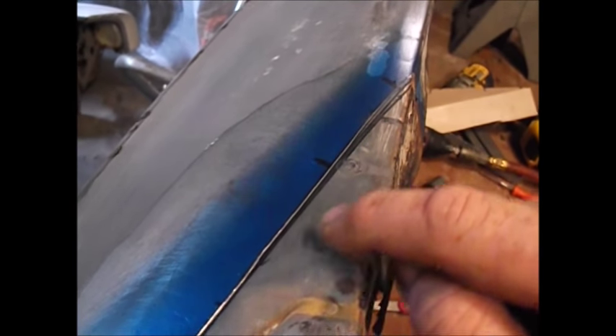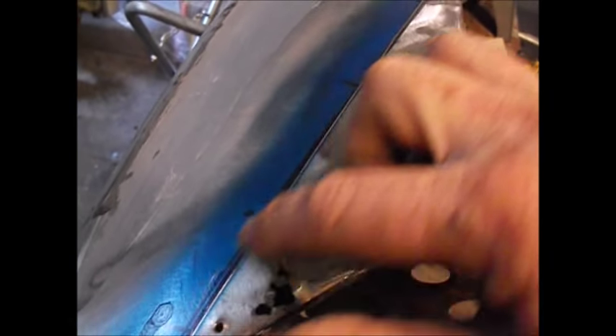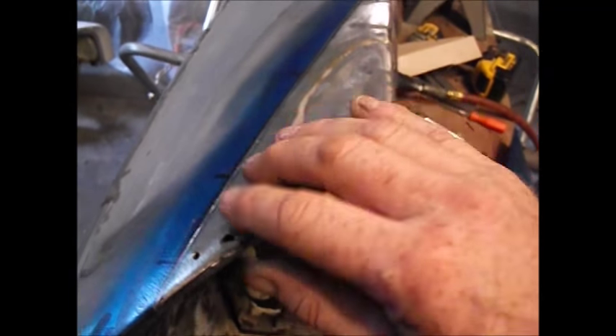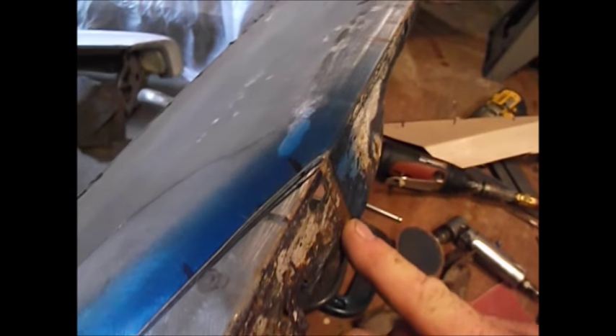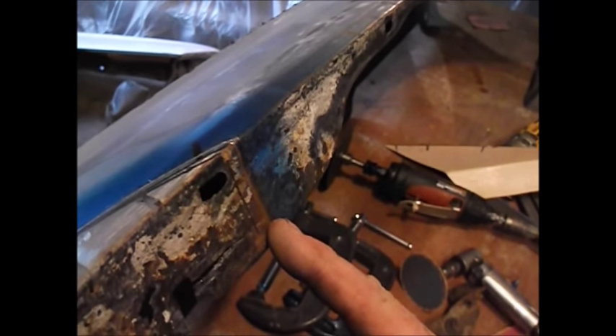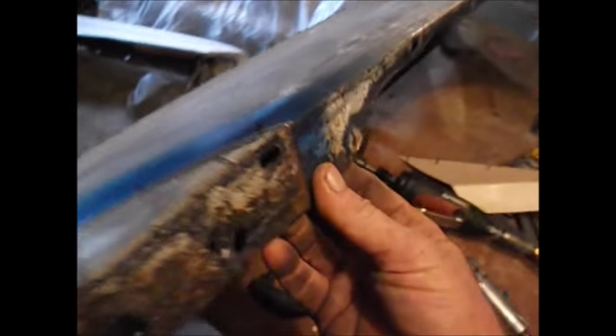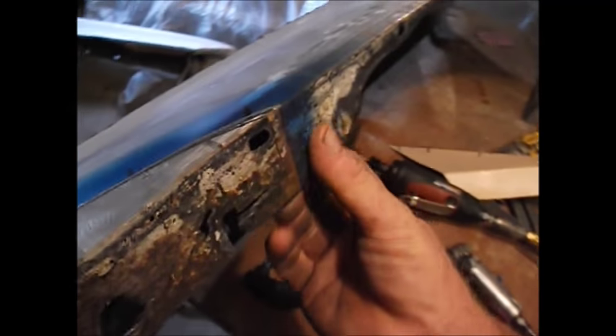I think for where it is I'm going to cut all this out short of my line, but up here I'm going to cut it right through here, measure real good, and put a flange weld right in here — just to give it some strength. If it warps or deforms it just a little bit, that's okay because we're going to have a lot of body work going on in here anyway. We'll have butt welds from here all the way around. The reason I like doing the flange is it's stronger — I can weld on the backside and not worry about burning through as bad.